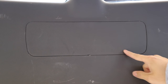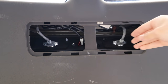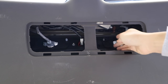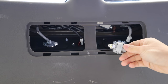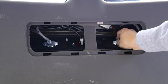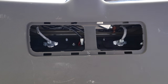Now we're going to replace the license plate bulbs from this access panel — very similar process. Right on the bottom, just pry up and that panel pops off. Again, we're looking at the back of the trunk here. Undo the clip — there are two lights for the license plates. Right on the gray piece, you can squeeze it, and there you go, that's the bulb. I've placed LED bulbs in there already. You just pull it straight out, put a new one in, and pop it right back in there. There is going to be a link in the description for all the bulb parts, the part numbers, and a link where you can go ahead and buy them.